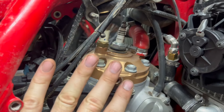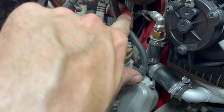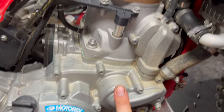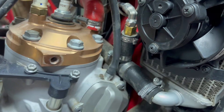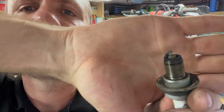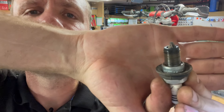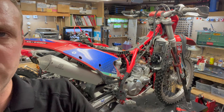I've got enough stuff off here that you can see what's going on. I have a whole bunch of stuff here that is different than stock. I'm going to drain the coolant and pull this stuff out — you don't need to see that anyway because yours is not like that; mine's the only one. Here is my spark plug. It's pretty good — there's definitely some buildup on there so I'll be replacing it, but it's not too dark, not too light. I've gone through a lot of jetting changes. This is the BP-R8 EIX that came with the TSP kit.